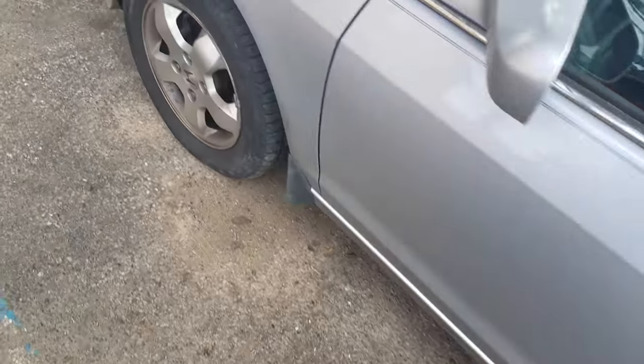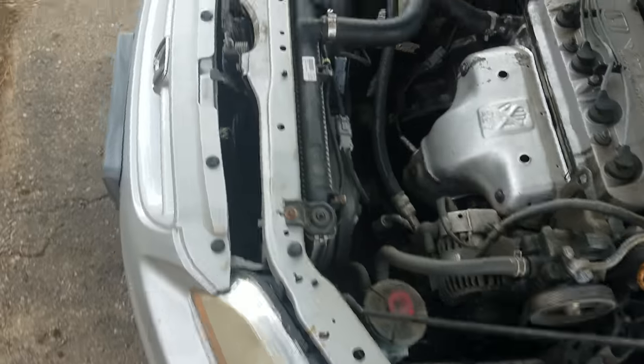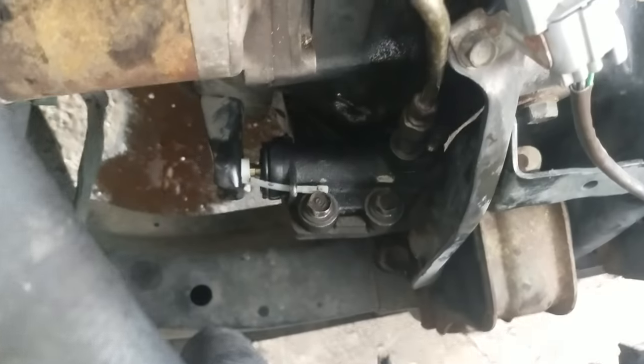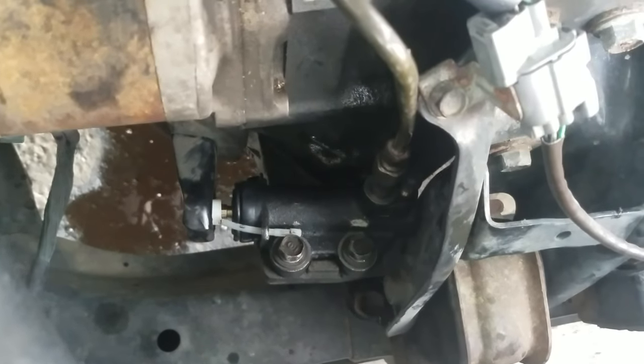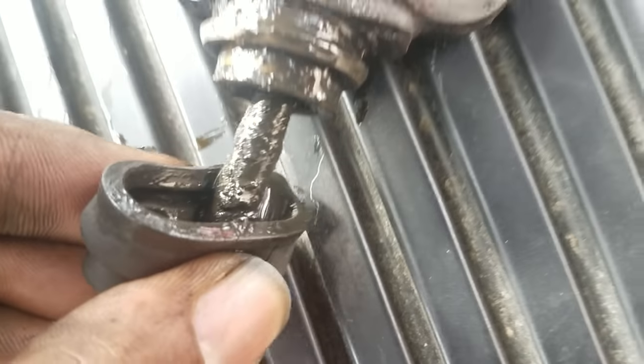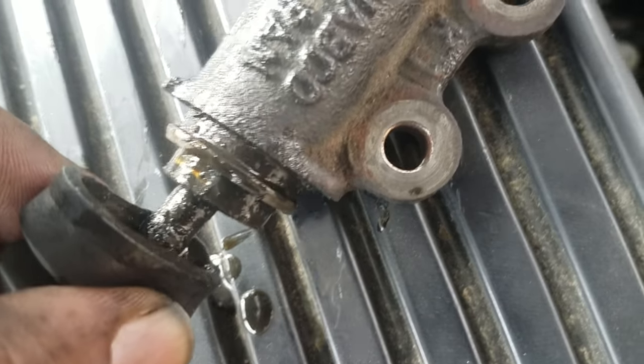So what I found out was wrong — I went over here to my slave clutch cylinder, which was mounted right there. I pulled this little boot back while it was down there, and it was all this old juice inside of there. Yeah, that fluid was bad. So I replaced it.